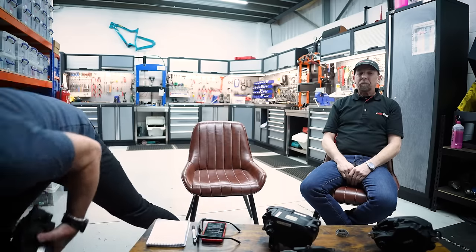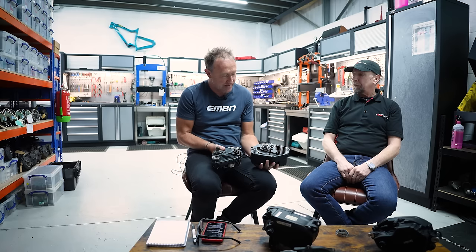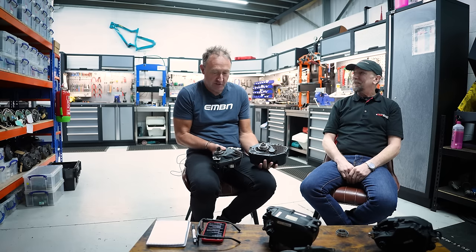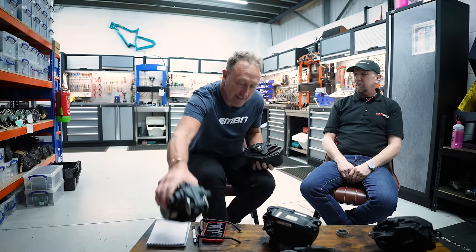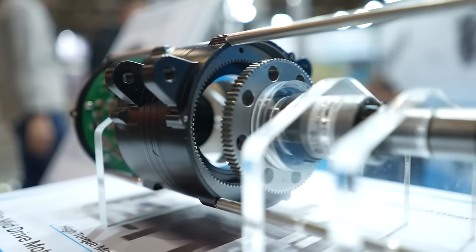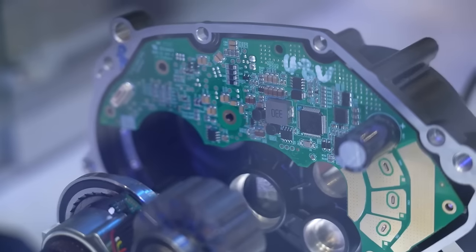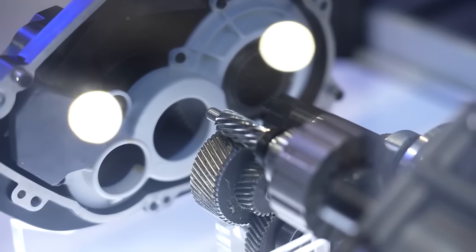Can I just have a look at that? I guess the weight - it's probably a little bit over three kilos. There's a problem, isn't it? Let me just go and get a Gen 4 here for a minute. You compare the size of these - the size is a feature of the modern day e-mountain bike. But as they're getting smaller and smaller, obviously everything's getting smaller inside - the gears, the bearings. So they tend to put up with less abuse.